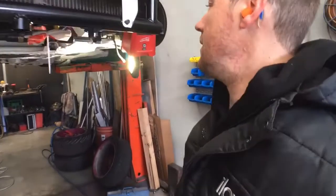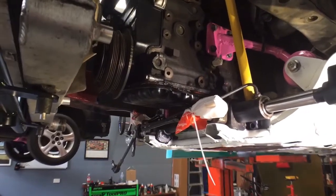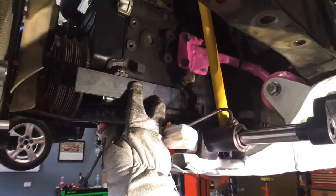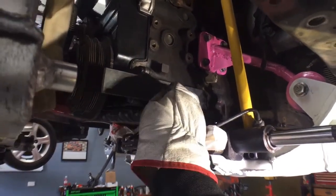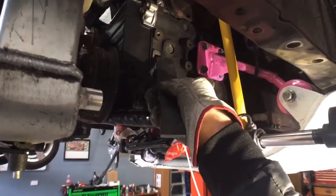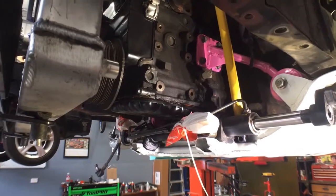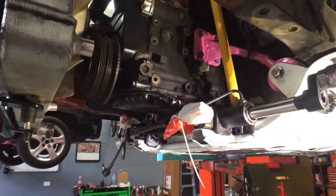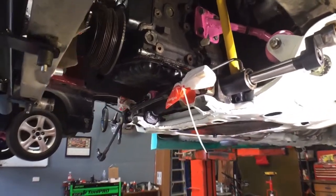Today I'm gonna be making the power steering pump bracket for the RB. So I've got a bit of plate, 40 by 8. I'm gonna bolt it to the side there somewhere and weld some little vertical walls off there and there, drill a hole through from the front, and I'll have to make a separate bracket up here somewhere to bolt on to hold, maybe those two holes, to hold the tensioner. I'll make a tensioner out of something. That'll keep that down nice and low. And yeah, let's get to it. Weld some bits and see how it goes. Hopefully it doesn't fail on anything.